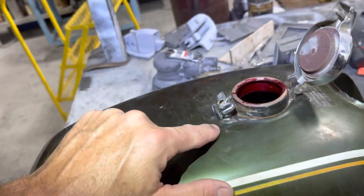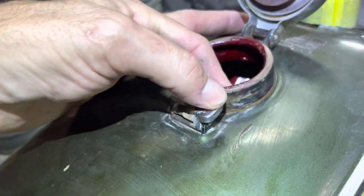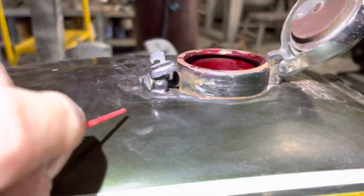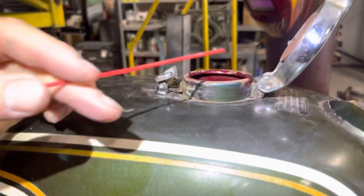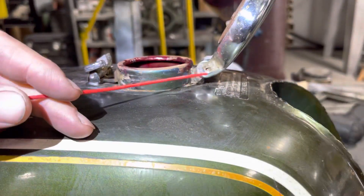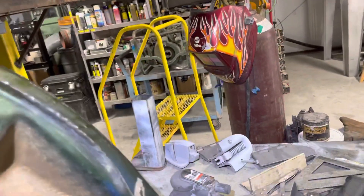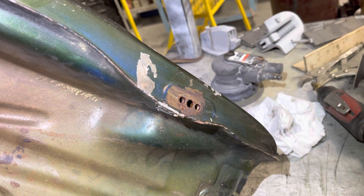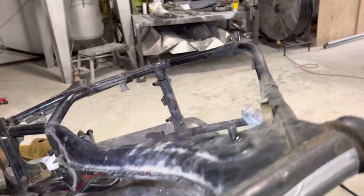Also underneath here, underneath this latch release mechanism, I'm going to have to drive that pin out. He'll have to replace those pins with aftermarket ones, new ones from Honda, or standard hardware from Amazon. This is prepping out a motorcycle gas tank. Those little holes there I'll plug or tape up, and all this underneath here will be blasted nice and clean. Same way with the frame.